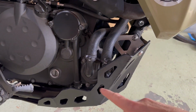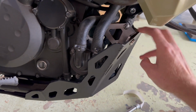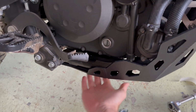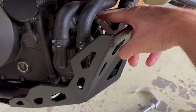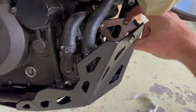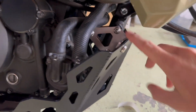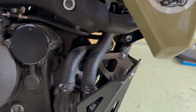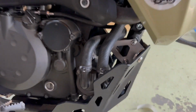So I was thinking last night how to do it the best way to get the Loctite on each thing. I'm going to tighten everything up with no Loctite. Then once it's all in place, I'll back out the ones underneath, Loctite, Loctite. Then I'll back out these, Loctite, Loctite. Loctite this one as well, the main bar, main bolt, nut and bolt. And then these two I can actually take out because they need to be able to come out. If I've Loctited underneath here and that one bolt, hopefully everything's sitting square, because it'll be a bit fiddly otherwise. Then I can do these two once I've got the crash bars on, because you've got to undo these and swap them out to these to get the crash bar on. So we'll see how we go.